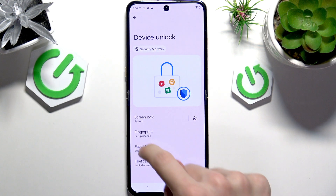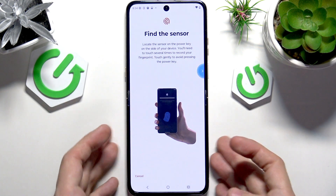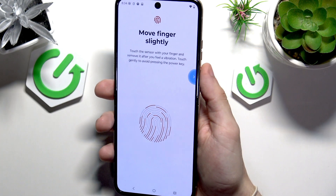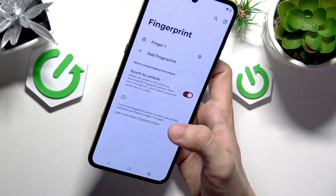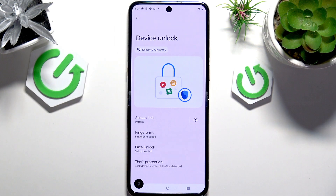Then click on Done and I'm going to set up the fingerprint — it's quite secure. Just enter your screen lock, then touch the fingerprint sensor after you click on Set Up. It's located on the power button. Tap and lift, then repeat that process several times. Remember to move your finger between each scan so it scans the whole area of your fingerprint. Once that's done, you can add another or click on Done. There is also the face unlock, which I'm not going to set up, because on this phone it only relies on the camera, so it's not too secure — it can be unlocked with a photo of you or by someone who looks similar to you. There are phones that use IR sensors which make it secure, but this one does not.